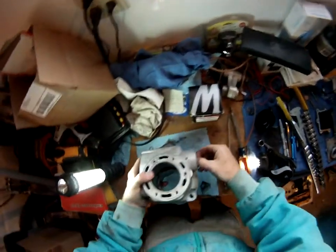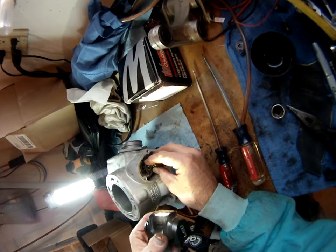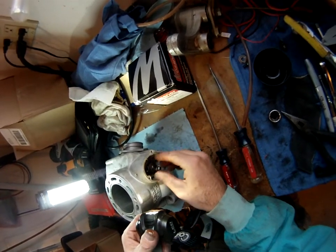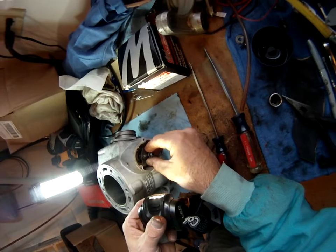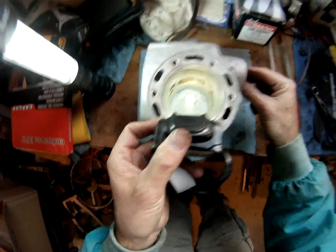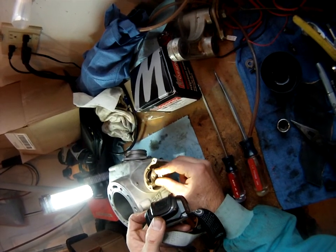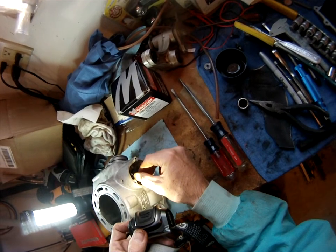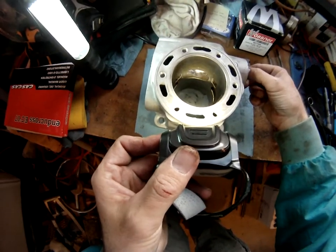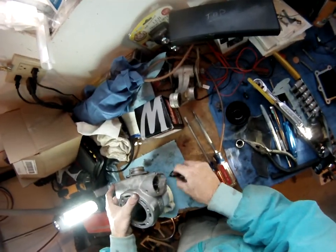That's power valve reassembly. Now, using the actuator arm - the power valve actuator - the rod comes up through here and attaches to this. When the engine spins faster that rod gets pushed up. This is power valve closed right here, you can see from the inside. This bolt that would normally be sticking out right here would be a stop for this little ear, so this ear would rotate around and hit the bolt and stop right there - that's power valve closed. As you raise the RPM this rod pushes up, rotates this around - at full RPM it rotates around and hits the stop there, and the power valve is way up inside - power valve open. So power valve closed and power valve open. Real basic assembly, real bulletproof, and once it's adjusted right it's pretty awesome.